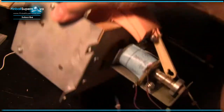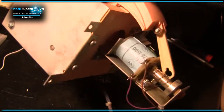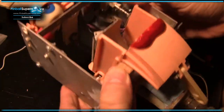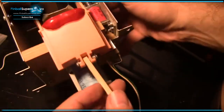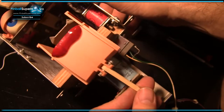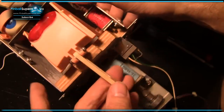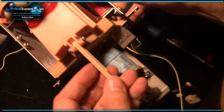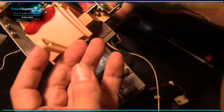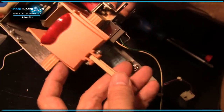Then once you've got those off, there's these screws on the bottom, so you have to lift the playfield up, undo them, unplug a bunch of stuff, and then pull it out of the back. And there's a whole other assembly. There's a motor here which drives the mouth that goes up and down, a little motor like that. That's a completely separate thing. I'm not focusing on that right now, but there's problems with that. There's a little gear that attaches to this that is a common thing that fails, and it's broken on mine. I'm going to have to replace that.